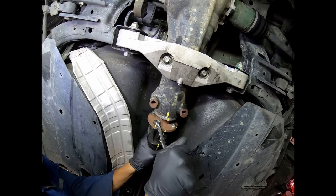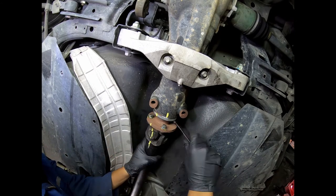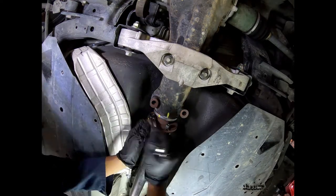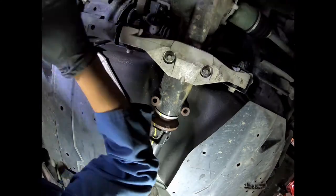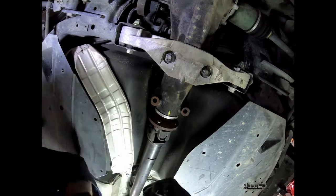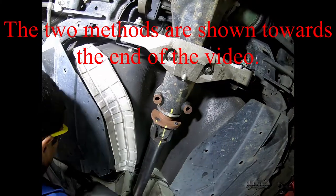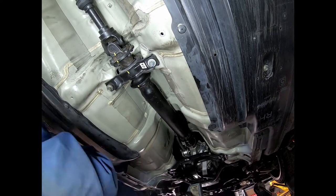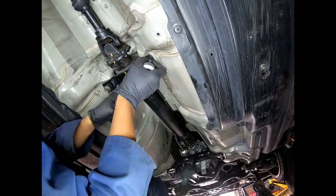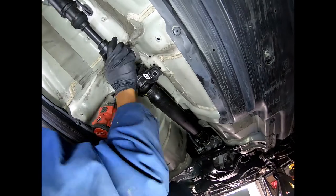When loosening the four bolts that hold the drive shaft onto the rear diff, with the vehicle jacked up on all fours you can put a screwdriver into the drive shaft at the pinion to hold it and loosen that way, or rotate it so you have access to two bolts and get someone to put it in gear and hold the brake. Loosen those bolts, then put it in neutral, rotate the drive shaft, and repeat for the other two bolts. Once completed, remove your drive shaft carrier — the two 14-millimeter bolts — and pull out your drive shaft.